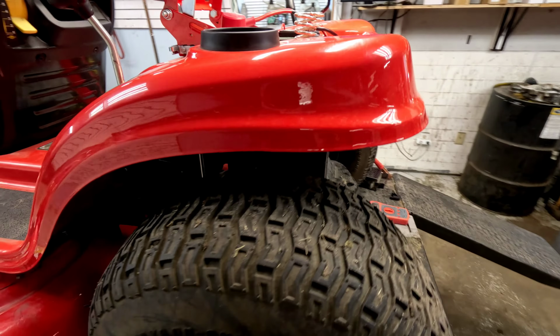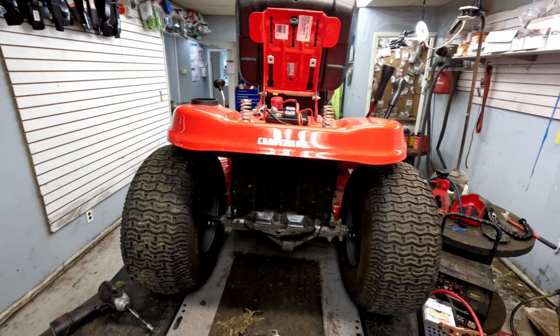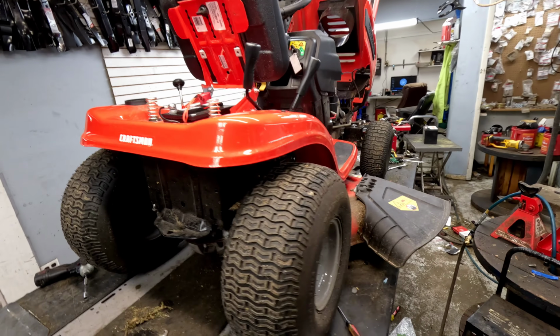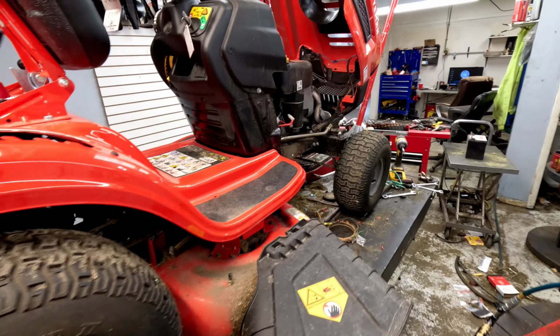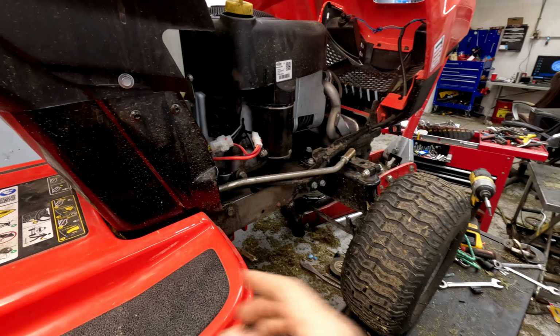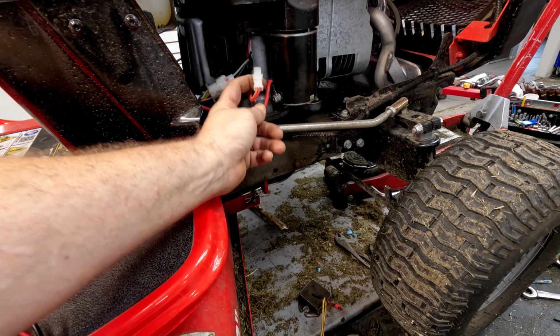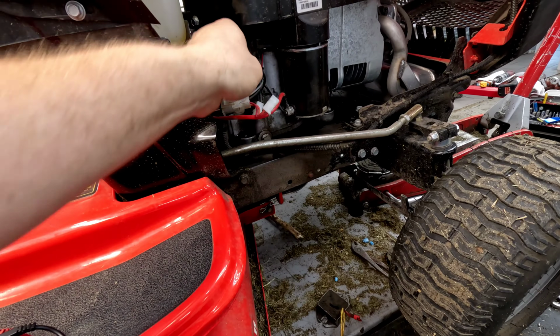So it is continuing to climb like it should. That is what a battery should do once it's started. Now that should top off right around 13.8 or so volts. If it doesn't, you definitely have an issue. Now to test your output from your stator, you find the 2 wires coming from underneath the flywheel.